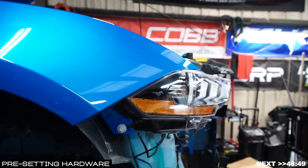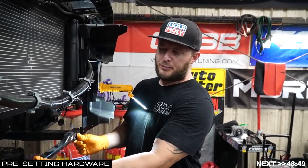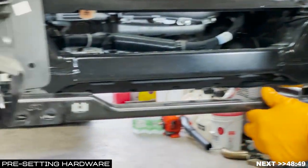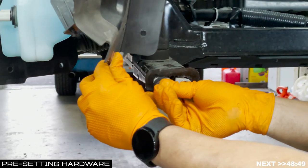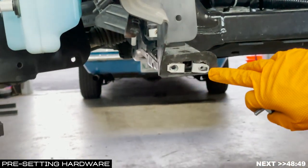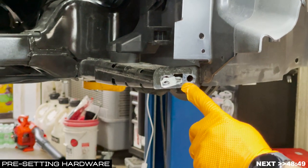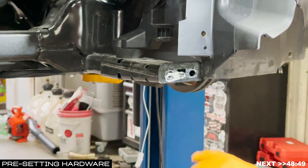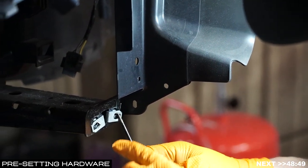The four little bottom bumpers install into small J-clips on the K-frame. The factory black crossbar gets removed at this point. Check both sides — on the passenger side frame horn both J-clips may be in perfect condition, but on the driver's side frame horn one may have fallen out. This is pretty common, so don't freak out. Use a pick or a flathead screwdriver to get in there and pull it out and clip it back on in place.